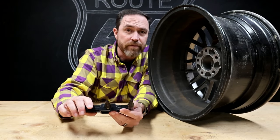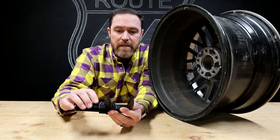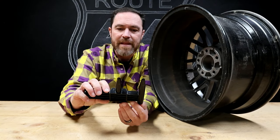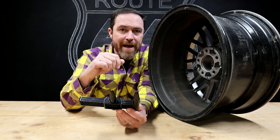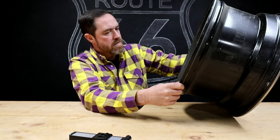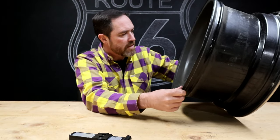On the bottom scale, it's showing 4.5. Now I know that this is a 5 on a 4.5, which is actually 114.3 millimeters. On this particular scale it doesn't have 114.3 — it just shows just under 115, but it's right on the 4.5, so this is a 5 on a 4.5. The wheel just says 18 by 9.5, so it doesn't actually give you lug spacing on it.